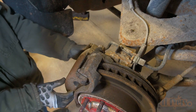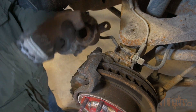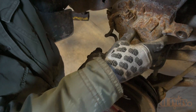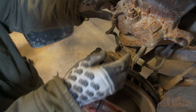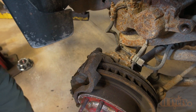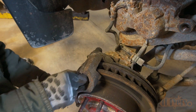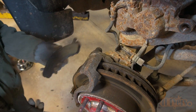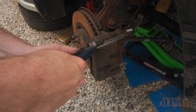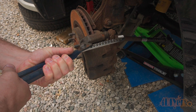Uneven brake wear can be compared between two pads on one wheel or from the opposite side of the vehicle. Just make sure you're comparing the front brakes and the back brakes not both together, as they use different components and different braking forces. When the wheel is removed you can turn the hub to determine if it's dragging. The hub shouldn't take much force to turn. If it does then there's something causing the brakes to stick on, and this can be caused by a variety of issues which I'll cover.